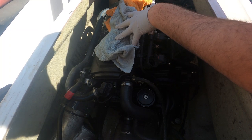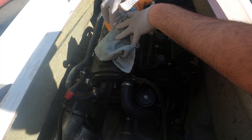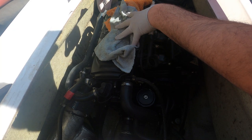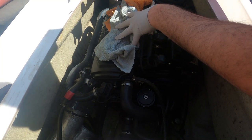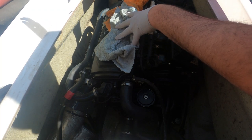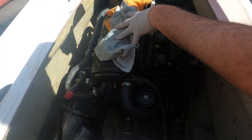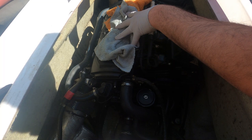As you guys can see, it's cranking now. I think the problem is the oil that was in the cylinder heads — there was too much oil to compress and that's why it felt like the engine was seized. So our problem is the oil leaking into the spark plug holes. We already got a new solenoid, a new starter, and a new battery, but before changing anything I wanted to make sure the engine wasn't seized — and it's not.